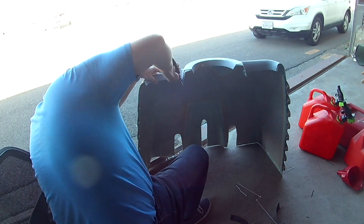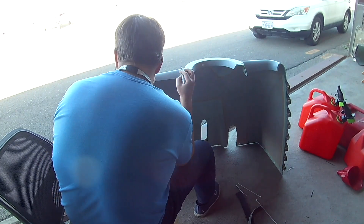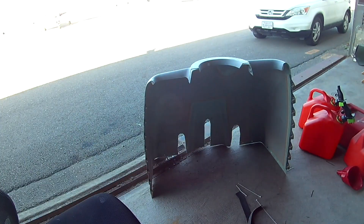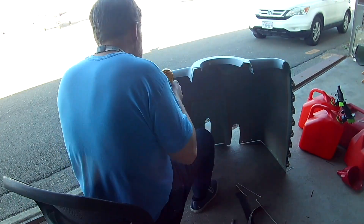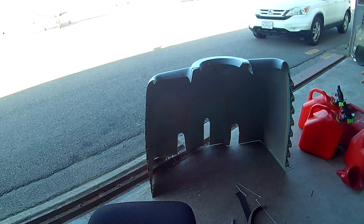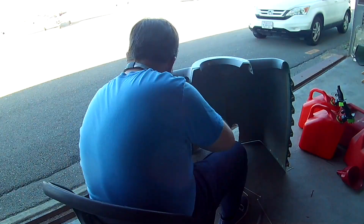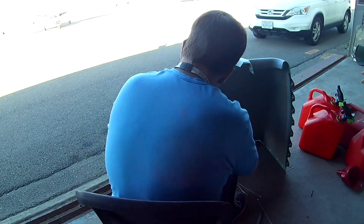I've been reading other people's accounts and they go as far as: if it's perfect and you know you're not going to need to take it off anymore, epoxy over the screw head so that it's perfectly flat. After it's done, to make sure you still have perfectly smooth air, you're going to be sanding off a lot of the regular cowl to make a swooping curve of the air inlet back so that it meets where the cowl material is going backwards. You've added a lot of material to the backside — this is not something you could do unless you formed the cowl that way. I think the excess material helps make it thick so that as you countersink, you don't have to worry about weakening the fiberglass. That's my guess.